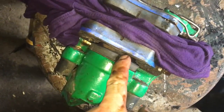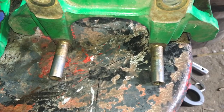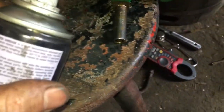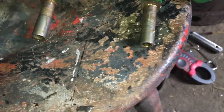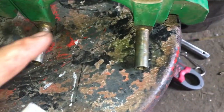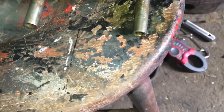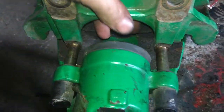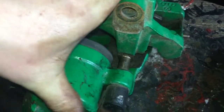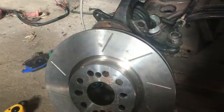It's hard to see but it was more flush before - it's after coming out. The next step is to get some copper grease and just spray it gently onto the tips here and here, so when it slides in it has loads of lubrication. That'll do.